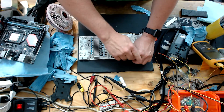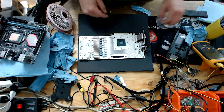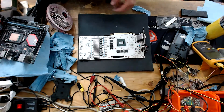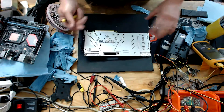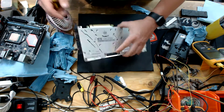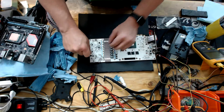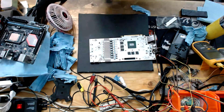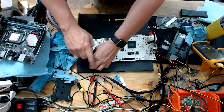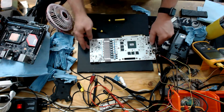This is the first time I'm testing a 10-series card and also the first time I'm testing this particular card. Once we've got those screws removed, that should pop up — and it does. One of the more important things to remember when stripping a PC is nothing ever has to be forced. Everything should just pop off with minimal force. If you find resistance, it's quite possible you've missed a screw. Right there I felt resistance — turns out I missed two screws at the back. You may also need a smaller screwdriver; they've used a much smaller head on that screw.